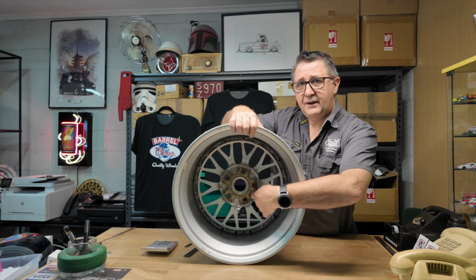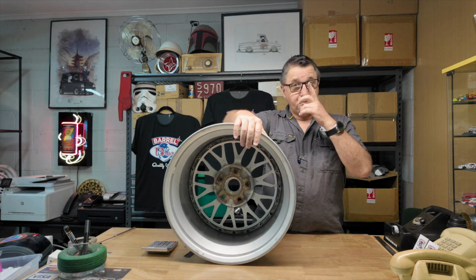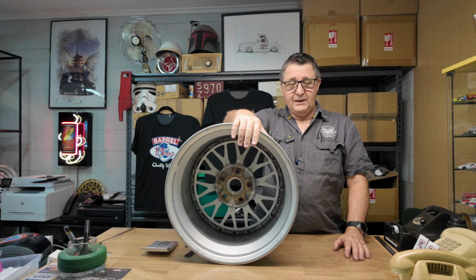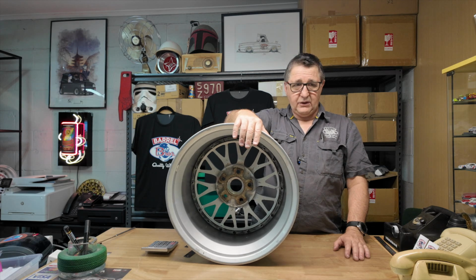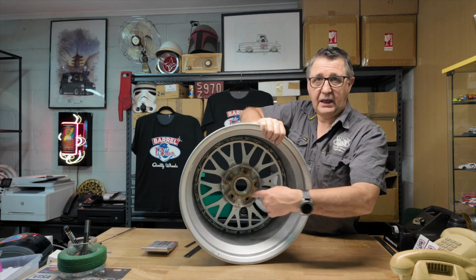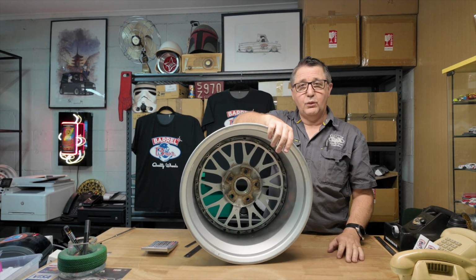Sometimes, I have had in the past where I just couldn't get the wheel balance right. This is how I learned about hubs, you know. I couldn't get the balance right, and I got a balance, and I got a balance, and it was just until a mate of mine said, why don't you try some hub rings? We put the hub rings on so that they fit the centre, and my vibration went away.